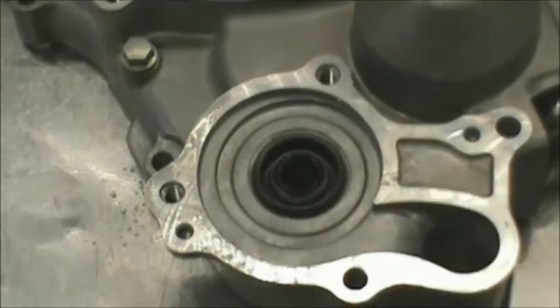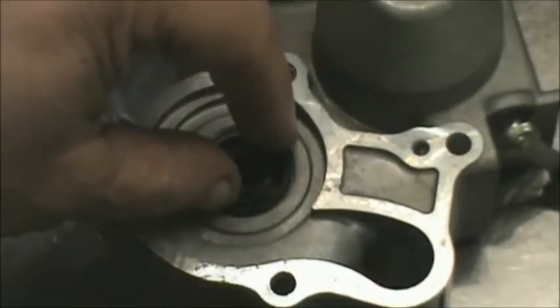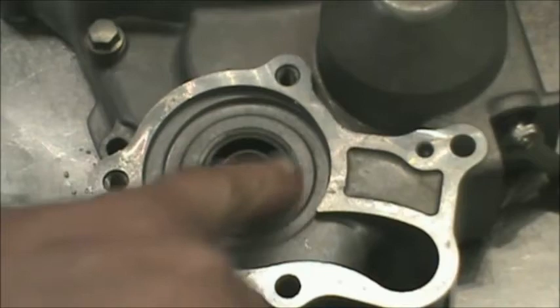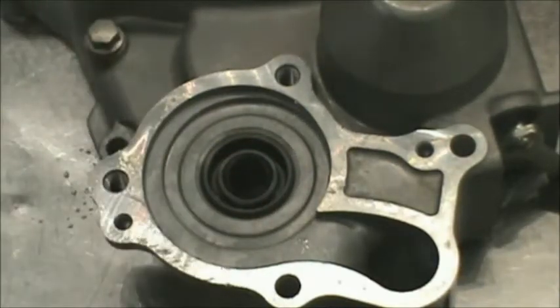Done deal. The actual water pump or coolant seal is lubed from Yamaha, but a lot of this stuff is relevant to other engines too. Make sure you get some seal grease in there if it doesn't have any. The other seal behind this has no seal grease — I'm just going to use a pick, put a little on there, and just go inside and move it around a little bit.